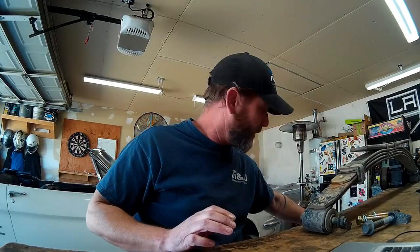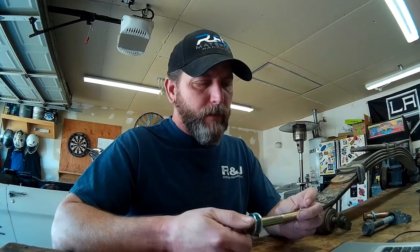I went to my local yard this weekend and picked up what I was lacking for the leaf spring install - the Super Duty spring hanger bolts. These are 18 millimeter bolts and they're very expensive new from Rock Auto, around $20 a piece. I went to the yard and got these for a couple bucks instead. While I was there I found some other goodies for the truck - some creature comfort stuff. In the end I spent $50 at the yard and got everything I needed and then some. I've also got some 5/8 hardware here for the shackle end of the leaf spring that came in my RSK from the front of my truck.